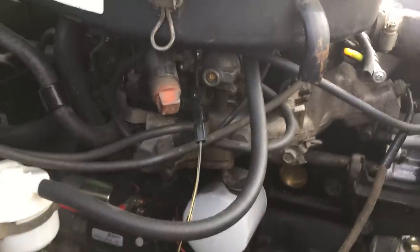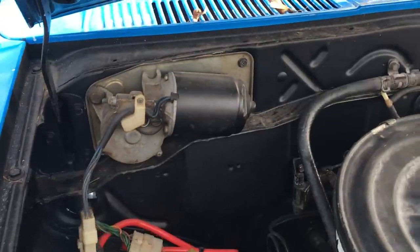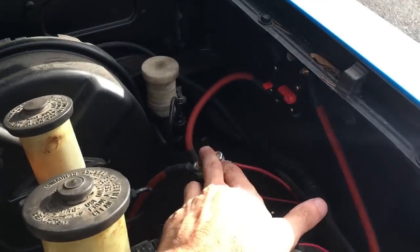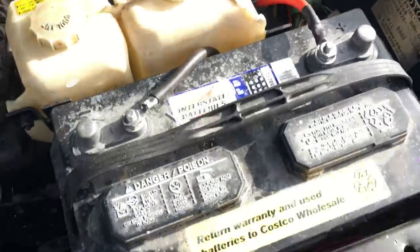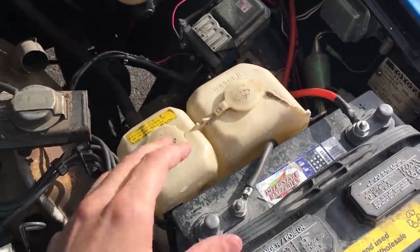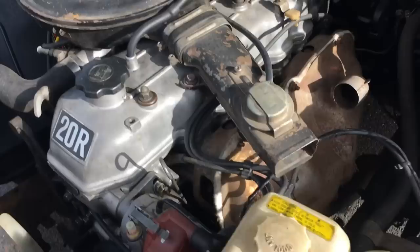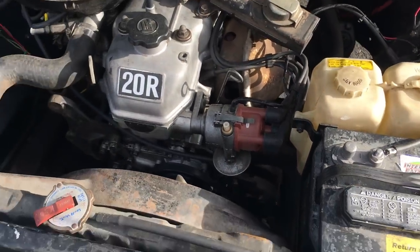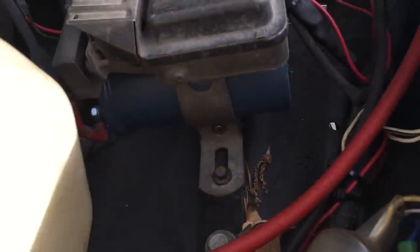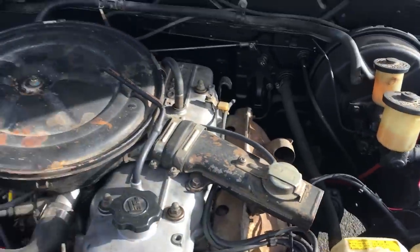Down here is the carburetor, oil filter, fuel filter, vacuum valve, windshield wipers, brake booster, and vacuum line hose. Here's some electronics. This relay connects the main battery to the auxiliary battery while the vehicle is running to charge the coach battery. Here's some overflow tanks and washer fluid. You can see the exhaust manifold down on the side. The distributor has been converted entirely to electronic ignition — it doesn't use the stock points. All that's required is the ignition coil and an ignition module on top.